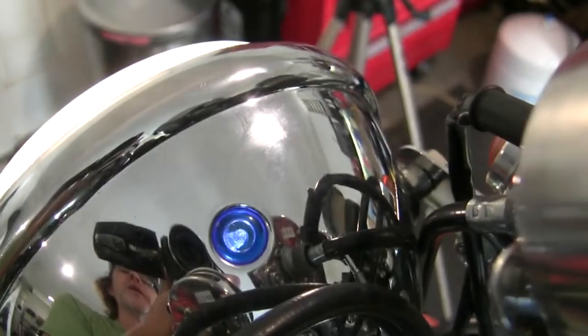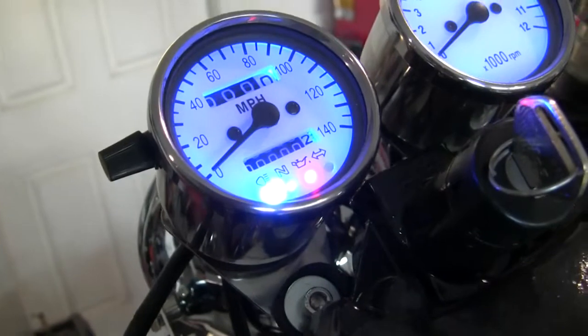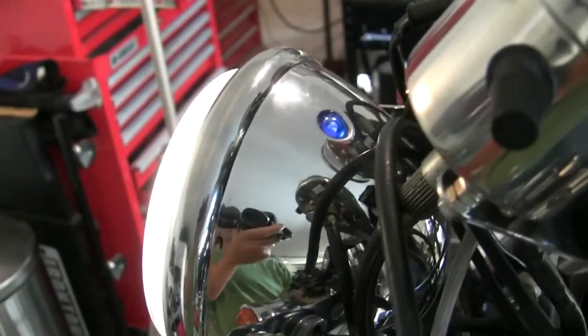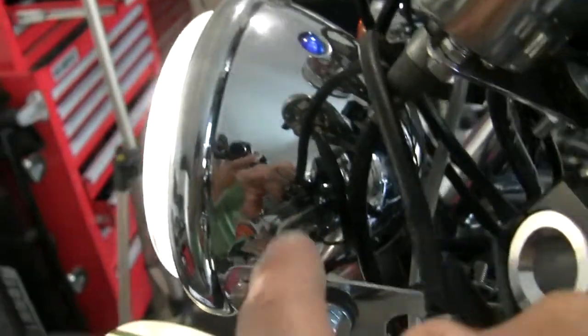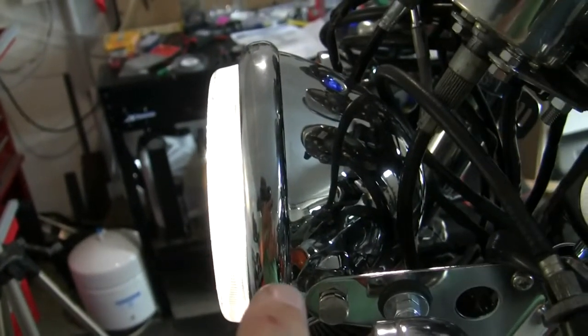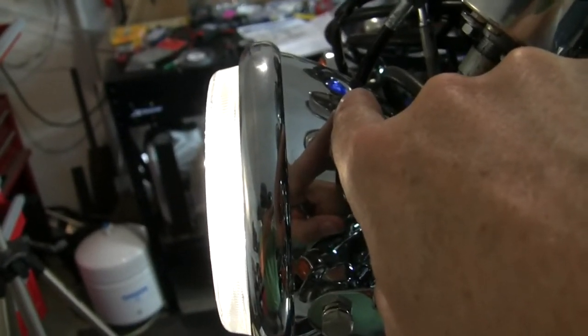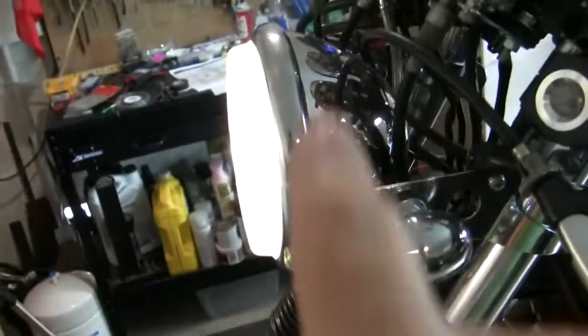This blue light was a little tricky for me. I was wondering why I couldn't get that thing to light up when I put power to it — I tried every combination of the four leads coming out of this. I took it apart and realized that the one lead coming to this, the hot lead, was a wire and the rest is ground. It wasn't working because I was going straight from my battery to those leads to determine what was what, and I wasn't powering the ground. Now I have the ground powered because I'm tied in with a test lead here, and lo and behold, I get that blue light.